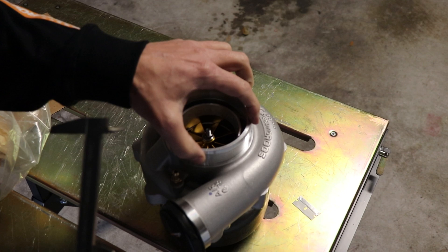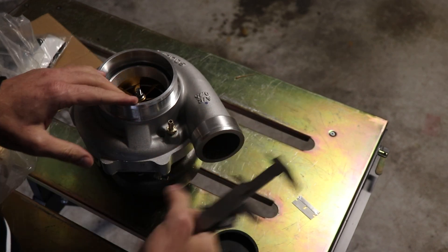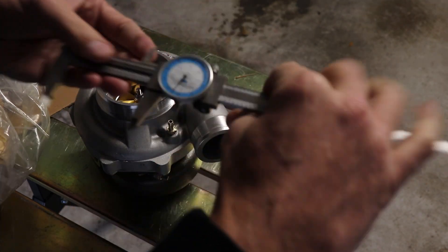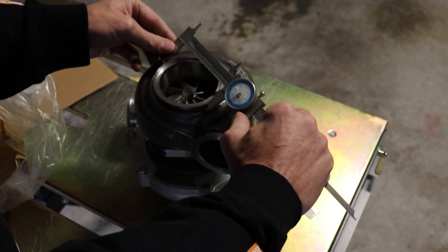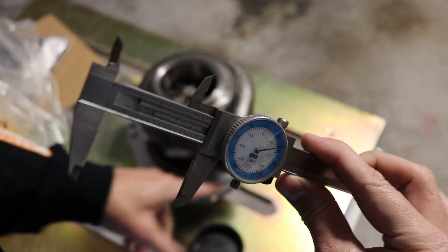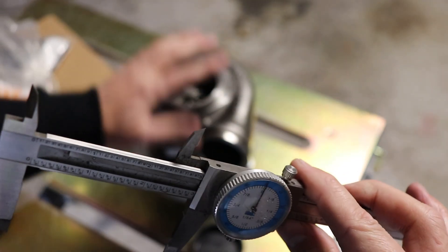Let's take some measurements. We have a little bit of a lip right here, but we're just over four inches — so a four-inch inlet on the compressor. The outlet in the center is just a tick under two inches. Outside diameter is two and a half inches. Inside diameter is almost three inches, but the very outer part of the flange is three and a half. A little over two and five-eighths on the inside at the inlet of the turbine, and exactly three inches on the outer part of the V-band flange.